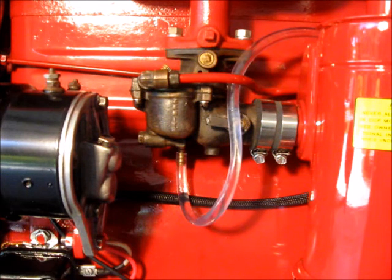So what we're going to do is shut the fuel off, and I'm going to empty my gas into a nice friendly bowl. Now I know it's impossible to see, guys. There was a little bit of Pepsi in my bottle here. Not a lot, but a few drips. But you see those floaties in there? That wasn't in there unless Pepsi sent it to me. So even when I drained out my carburetor, I did get a few specks that fell through as I ran it and did all this stuff.